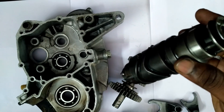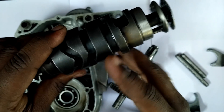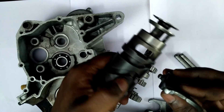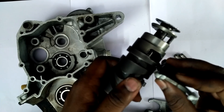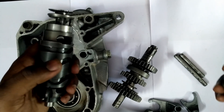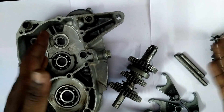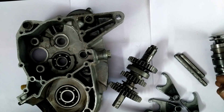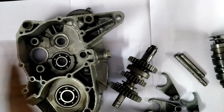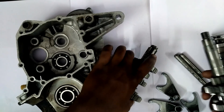There are two different dogs in both driving and driven gears because when you are in first gear, the first gear has to disconnect and the second gear has to connect. The drum acts like a choreographer — it has three different parts for three different forks. When you are shifting, in that millisecond, the drum disconnects whichever gear you are in and connects whichever gear you are going to. Since motorcycles are a constant mesh gearbox, you can only go progressively — like in a car you can go first, third, fifth, but on a bike you can only go one, two, three, four or four, three, two, one. You cannot jump gears.